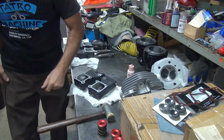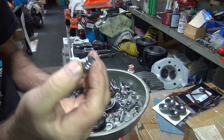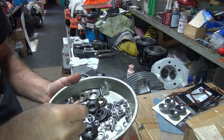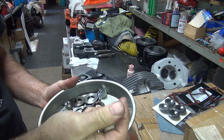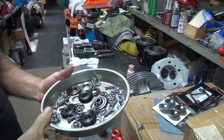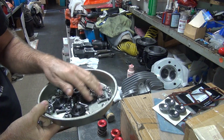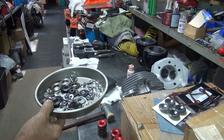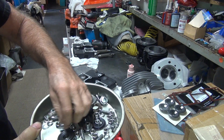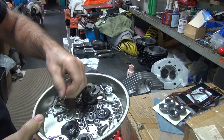Okay, flip it around, get the hardware. So use a cap style nut here. Just not using the stock ones with the red dots on the end of them, red caps that fall off. These ones are a lot better, they don't fall off. For some reason I only see two, there's a third one. There should be little thin washers, here you go. These are sealing washers, you've got to use them. It's best to use them anyway. There's three, and there's the fourth one.